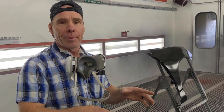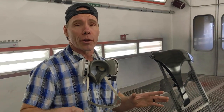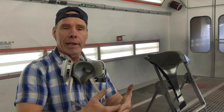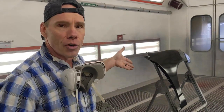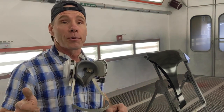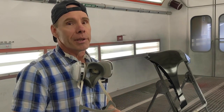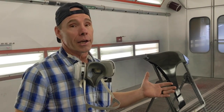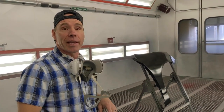To explain the clear coat a little bit: this is a one-to-one ratio, 77.3% solids clear coat — super high solids, double what the normal solid rating is on most clears. We're going to apply it with what they call a half coat followed immediately by a full wet coat, with no flash time in between. On a large vehicle, you do the half coat first, then come back and nail it with a full wet coat. Then get out of the booth, flip the switch, run it up to 140 degrees for five minutes, let it cool down, and it's ready for polish and assembly. The stuff is phenomenal. They said it's not a urethane clear — they won't tell us what the chemistry is — so we're okay with that.